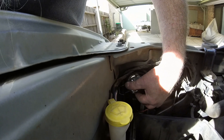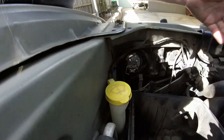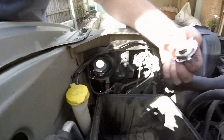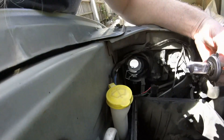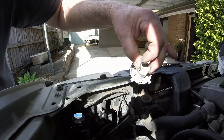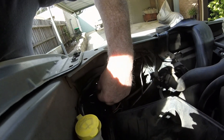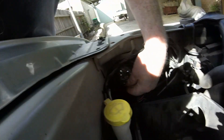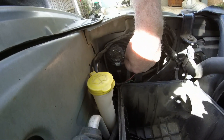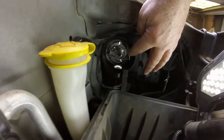Be very careful - you don't want to drop your headlight globe down in there. Not that it matters much if you're changing it since it's probably blown anyway, but you don't want to go fishing for it. Then just take your globe out and that's it. When you put it back in, one thing to remember is the middle terminal - the top terminal - you want that facing the top obviously. If you get it orientated right, this clip has to go back over it, push it to the bottom and get around the little tab that's down the bottom here and push up.